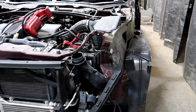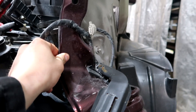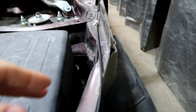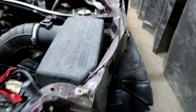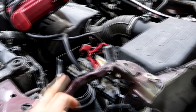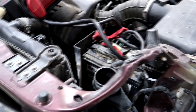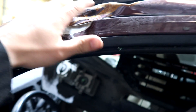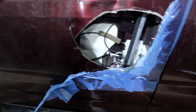Basically on this side right here, as you can see, this thing is a little bit shifted this way. It's supposed to be straight — looking at this side, it's supposed to be straight. I'm pretty sure I can straighten most of this out, and the radiator support I'm pretty sure I can straighten out as well. This fender is getting replaced — I have a new one. The A-pillar is messed up; it looks like it's just the skin, nothing crazy. This door is getting replaced — I'm actually looking for one right now. As soon as I get most of these parts in, I should be able to get started working on it.